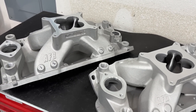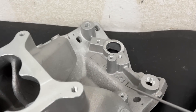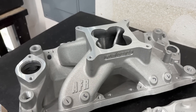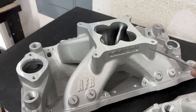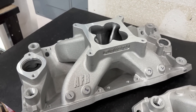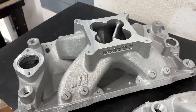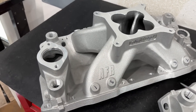What we have here are two intake manifolds for a small block Chevy from AFR. I'll give you the part numbers and some breakdowns. First off, this is part number 4811 from AFR — this one is going on the dyno. I'm recording this because I'm getting ready to drop off all the parts to put the dyno engine together. We'll actually get to see the dyno runs from this manifold with a set of AFR 195 Enforcer heads — it's an all-roller deal.